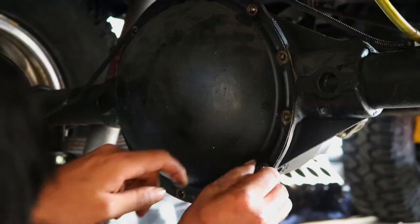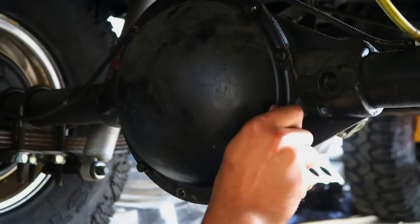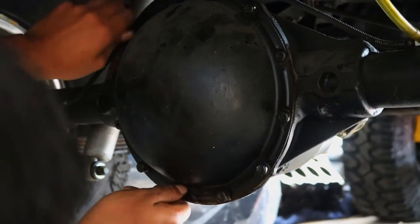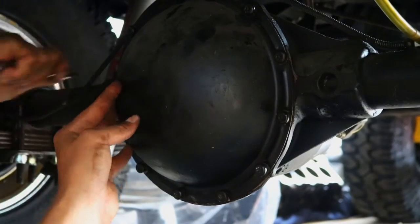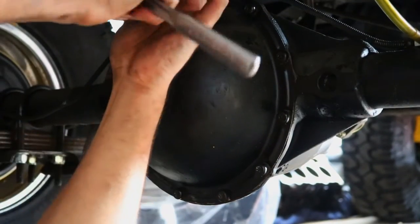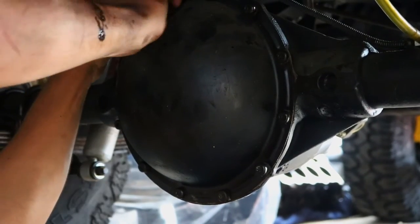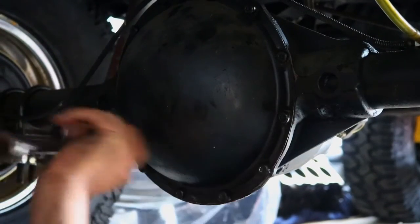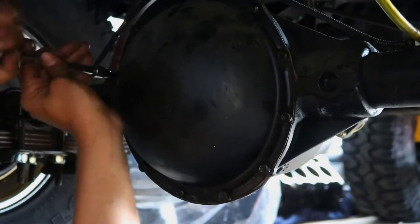If you're doing this job by yourself, the best thing you can do is hand-tighten them and do it in a star pattern. Before you finish everything off, get yourself a torque wrench and torque them all to spec. I did reuse the old hardware, but I read on the forums that a lot of people replace these with stainless steel or grade 8 hex head bolts because these star-head torx bolts tend to strip out and get weak over time. In the future I plan on changing these out to a hex head type bolt.